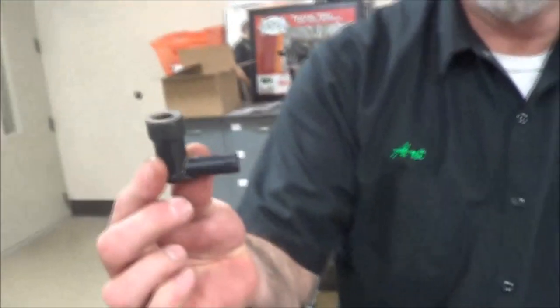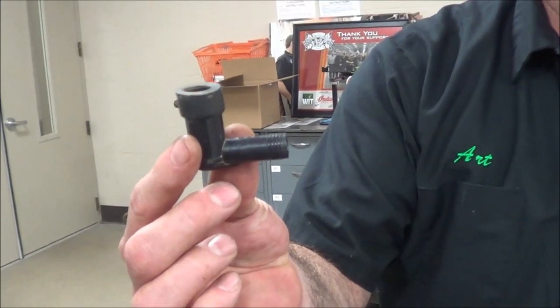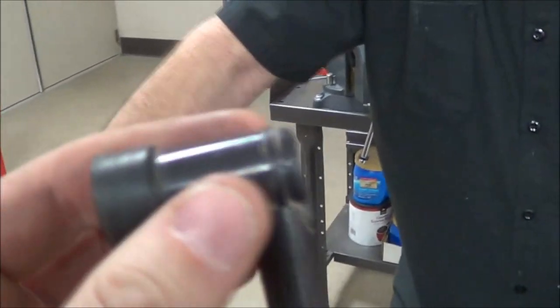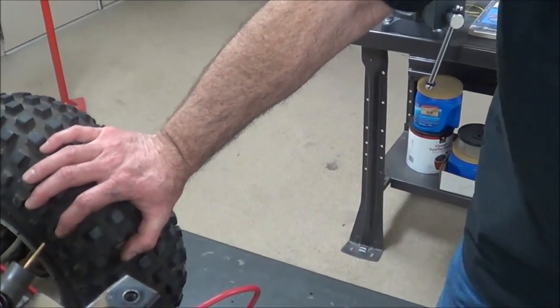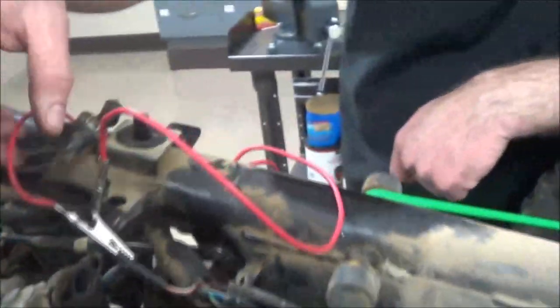One of the other things we discovered was a bad spark plug cap. We found no spec in the manual for it — most manuals will say around 5,000 ohms, but not this one. This was a cheap aftermarket one with no part number on it. So what we did was put a known good spark plug cap on there, jumped the neutral switch with our own ground wire, and verified that we actually had spark. We gained spark — life was good again.